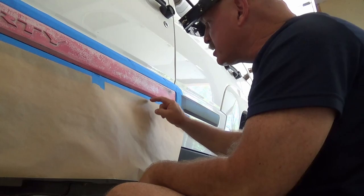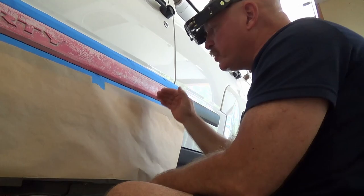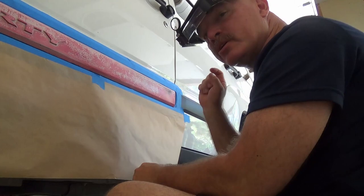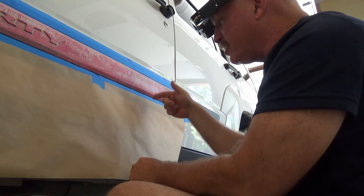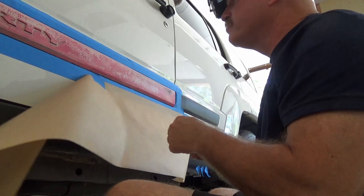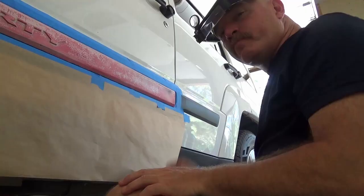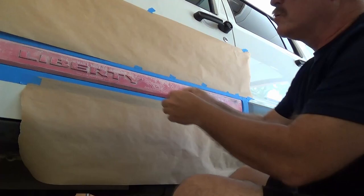Keep that tight — even though it looks like it's right up against the tape, it may be raised off just slightly. Especially when you spray, the aerosol creates an air current and it can easily pull this paper away from the tape. So you want to add a little bit of tape along this edge. As soon as that aerosol breeze hits it, it'll just flap and put all that overspray right down on your paint job — and that's no bueno. Work your way all the way around the project and get ready to paint.